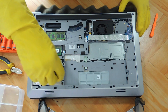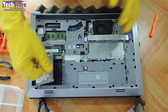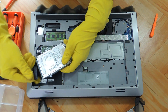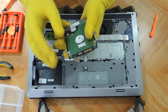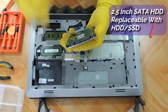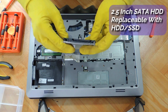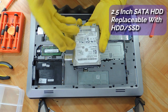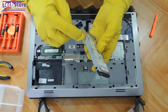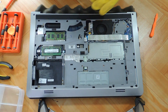This is where the hard drive is — you need to remove these four screws and the hard drive will come off. There is a SATA connector which you need to remove. You need to buy an HDD or SSD depending on your usage. This is a 2.5-inch SATA HDD. You can upgrade it up to 1TB or put in an SSD. Just remove the 4 screws to remove the casing of the hard drive and you are good to go.